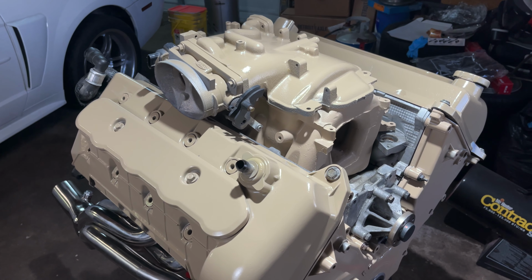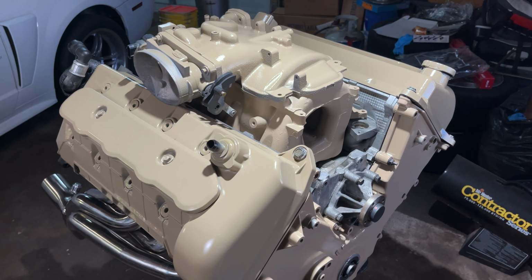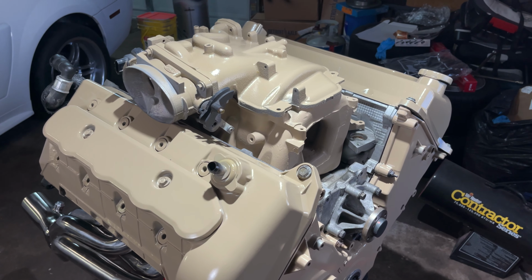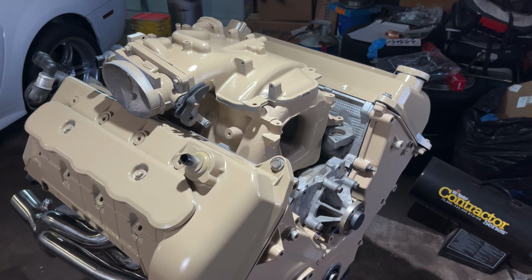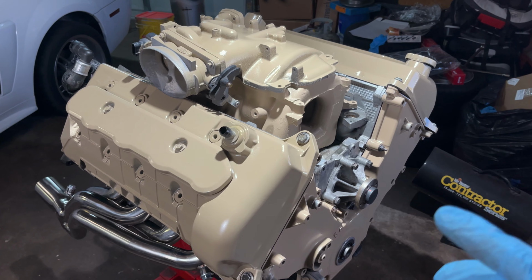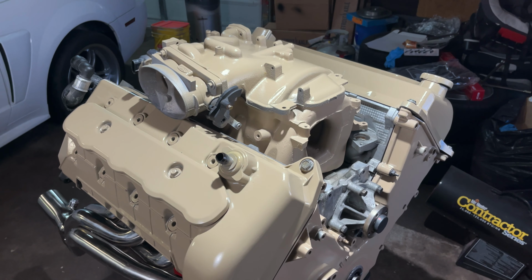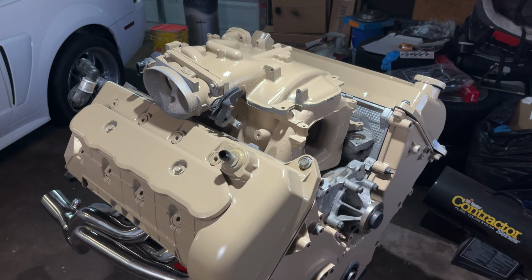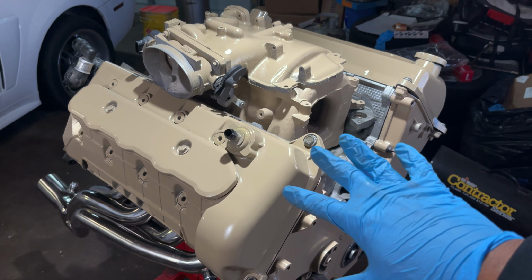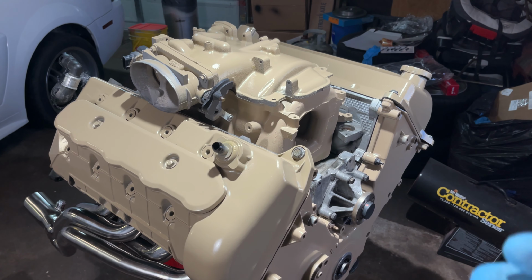I am going to degree it. I'm just going to go ahead and do it. I got some feedback from some of you subscribers out there who want to see me degree it. So I'm going to degree it. I've got to order the Trick Flow kit and a couple of little pieces. I'll degree that, but first I've got to take the heads off, lap them, clean the deck surface.